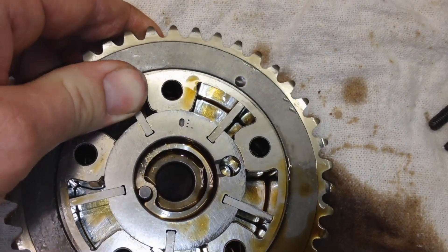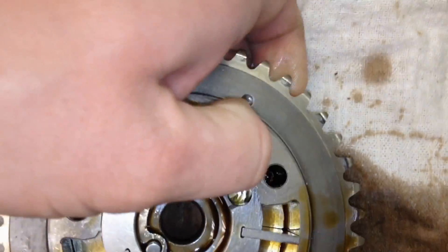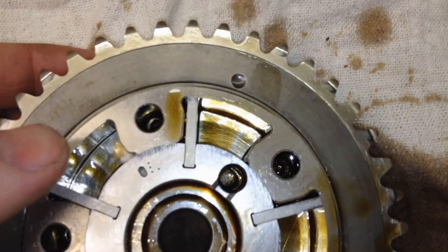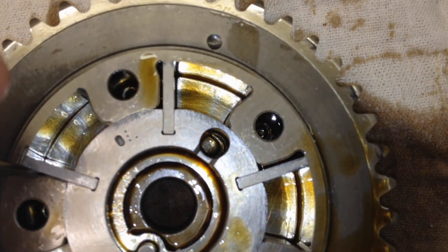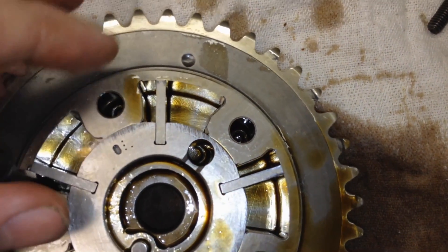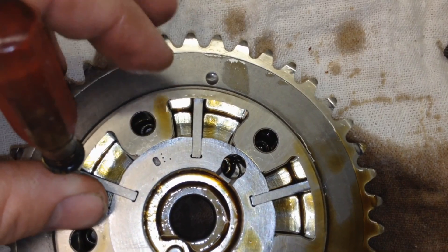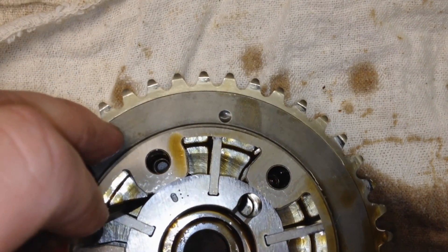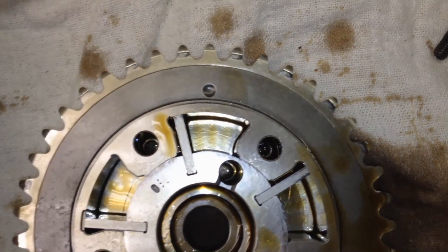Now that it's advanced it's a little hard to get out of that initial position. You can see down the hole as I bring it back to base timing — there, it just popped back into base timing, and that's where that pin locks back down into. Once it's allowed to advance, usually over 1200 RPM while driving, it starts moving and can literally adjust the timing independent of what the actual timing is on the chain itself. It comes back and pops in, locking it at base timing.